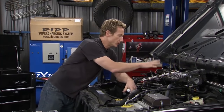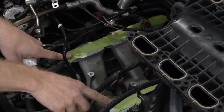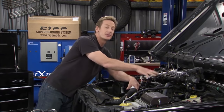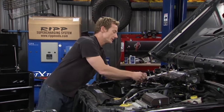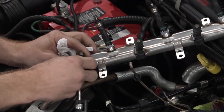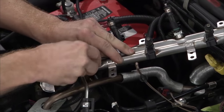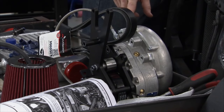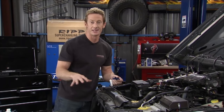The plenum is off and the fuel rail is out, now we can start swapping out those injectors. We put masking tape across the intake manifold to make sure we don't drop anything down inside the engine and to keep dirt and debris out. Takes about a minute but can save you a lot of time. The old injectors can sometimes be removed by hand or with a screwdriver to pop the clips off. The restriction is these old injectors — by putting in a new set of bigger injectors from the RipMods kit, we'll be able to feed more fuel and make more power.